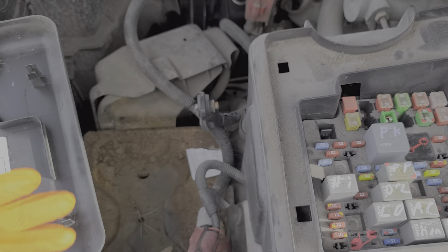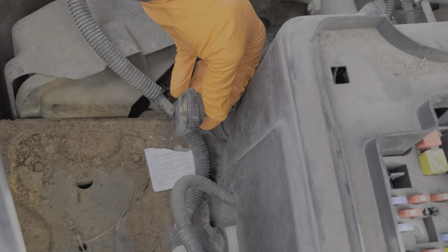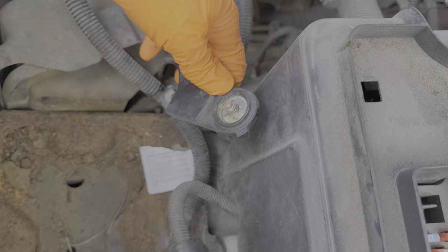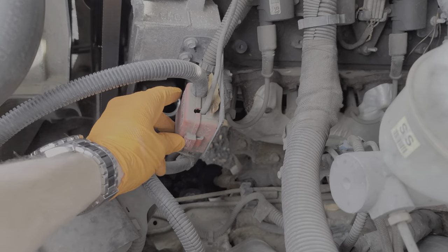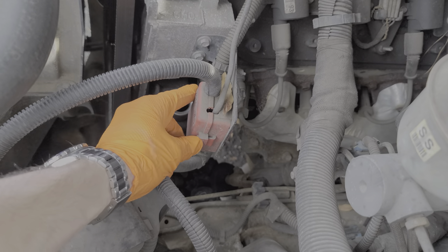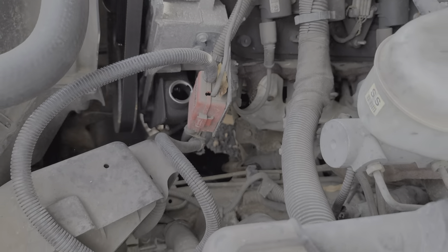While you're here, the battery is right next to the fuse box. Make sure that these connections are both clean and tight, and you'll also want to be sure they're free of corrosion. These side post battery connections are notorious for having problems with connectivity. There's also a junction in here — you can pop this cover open and make sure there's no corrosion in there as well.